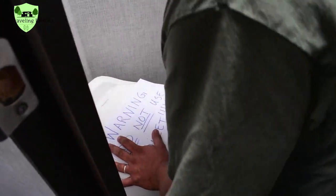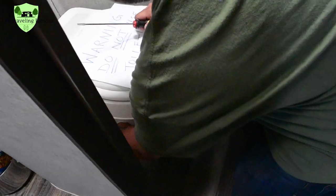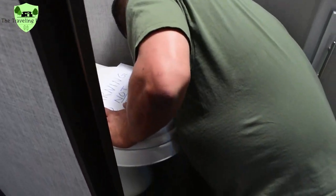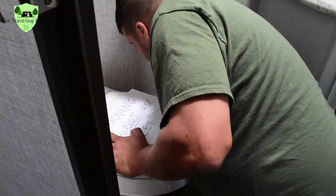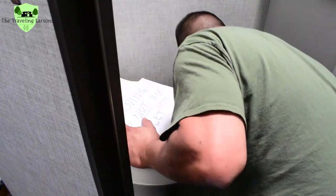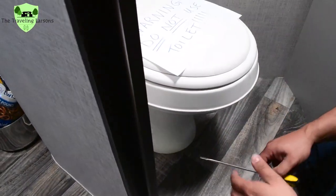Very close quarters, but I have the GoPro going in here too, so hopefully we can get some video of that. Just like any residential toilet, this has caps covering the bolts into the floor. Because we're currently parked at Jennifer's parents' house, the water is turned off to the toilet, so on the back side of it I should just be able to unscrew the water line. Just a little bit of water dribbling out, but that's all right. Use a flat head screwdriver to pop the cap off.